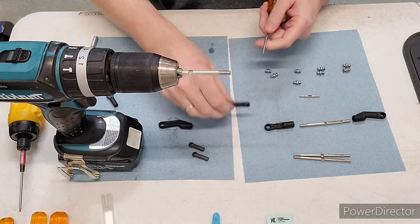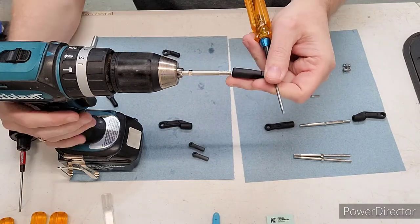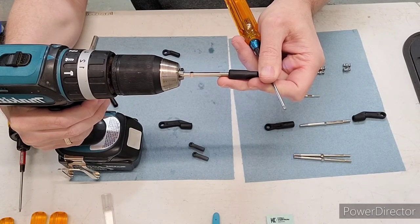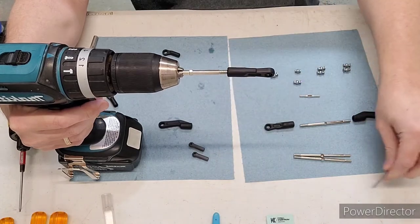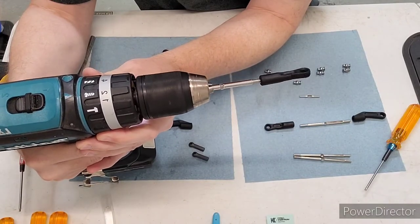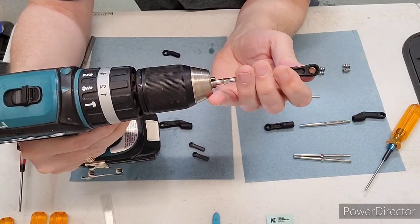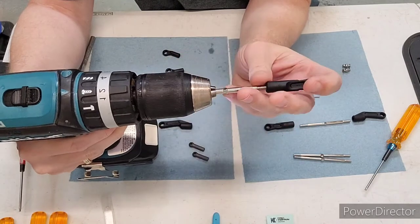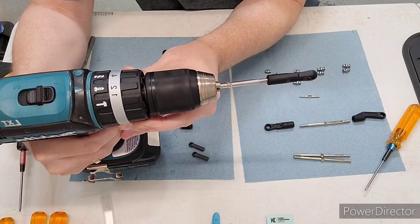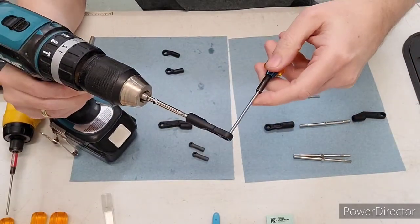What I do is stick the turnbuckle through my hex wrench and hold it on the turnbuckle, then just blip it to get it started. I'm going to hold it this way, rotate it, and you can kind of see it's wobbling a little. So you figure out where it's not aligned and then you can massage it into alignment. Now you can see it's pretty good.